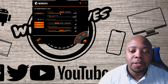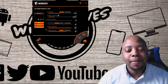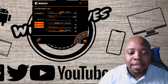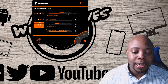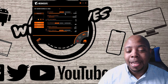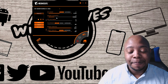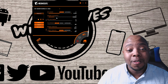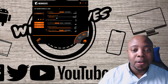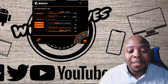So GPU boost. If we want to do overclocking, which I will be doing in a separate video, not in this particular video, because that just needs some attention by itself. But if you want to overclock, you could definitely slide this over, and you could change the actual boost or what the card goes up to. The highest I've gotten it up to was like 140 plus megahertz. So you could definitely play around with that. And really, with the 2080 Ti, you really don't need to overclock it, especially since this is already overclocked out of the factory. The boost clock on the card right now is at 1770. So I mean, what else do you need to do?